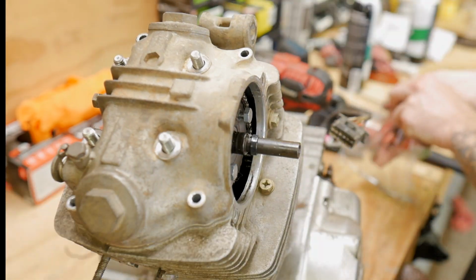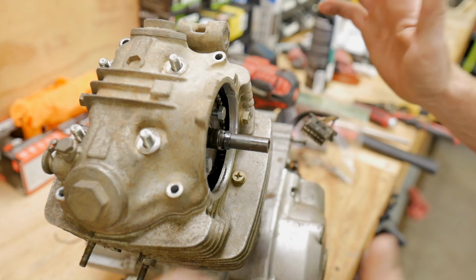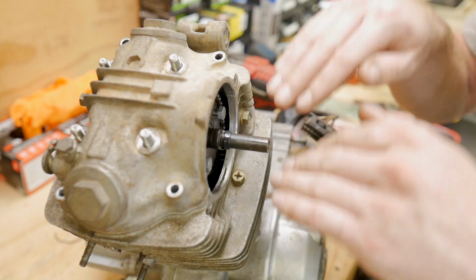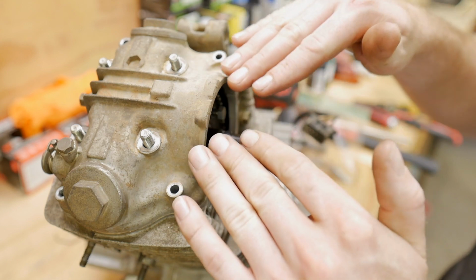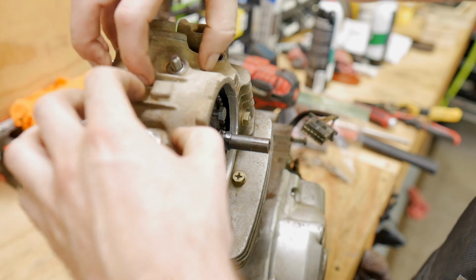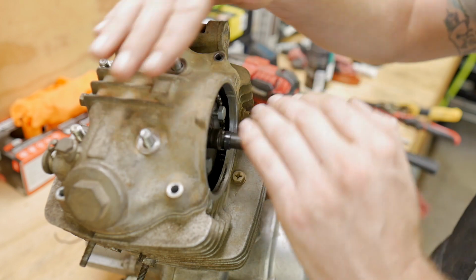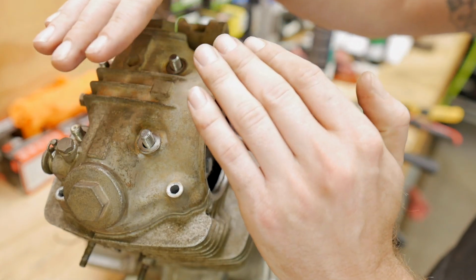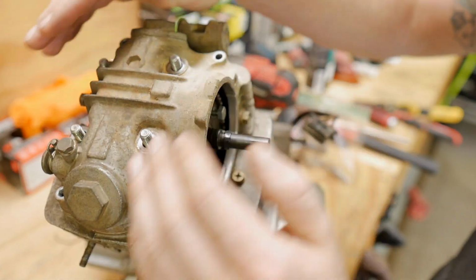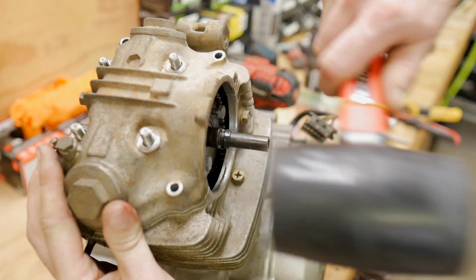Oh, it popped. That's because the cylinder is not in top dead center compression. I can't turn it to that degree. We got it to move like you saw, but there's pressure on the intake valves, or the camshaft per se, and because the camshaft uses the valve cover as a bearing surface, which I'll explain, you'll see it when we open it up, there's pressure on the valve cover. If I were to turn this into top dead center when there's no pressure on the cam, it wouldn't have popped like that, but that's helpful. So let's finish it off.